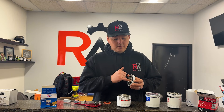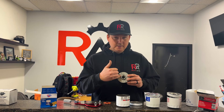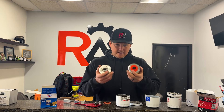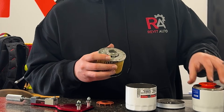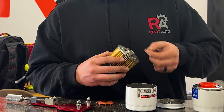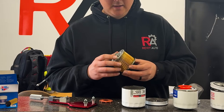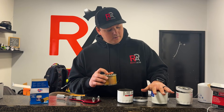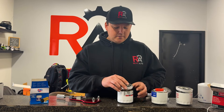Just to go over the main construction of your filter: your sealing O-ring, the threads that thread into the block or oil filter adapter, and the top and bottom of your oil filter. This filter has a bypass valve on the top; this one has it on the bottom. If I could get the combination of both — the fantastic pleating of the Blue with the top bypass valve of the Motorcraft — that would be ideal. But the gluing on the Motorcraft is absolutely gross; I can literally peel some of it off. That glue could get lodged in the filter or make its way through the upper bypass valve.